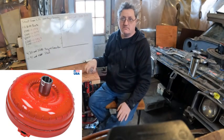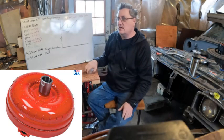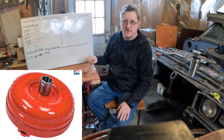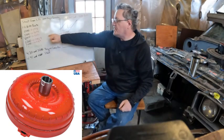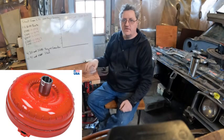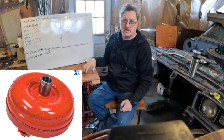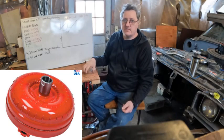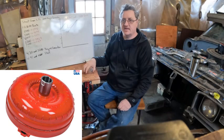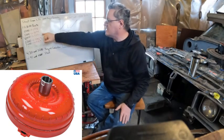Looking at this 3274 RPM drop, you can call up a converter company and have them spec a custom converter, or get one off the shelf, probably a lot cheaper. Depending on the weight of the car, the gearing, and the torque of the engine — if you have a small block without a power adder — you could probably go 3500 and it would be okay. But if you have a larger engine like a 454 or a small block with a nitrous kit, a nitrous kit can add 200 foot-pounds pretty easily, so you want to be conservative. For most people watching this, a 3000 stall would probably be the best choice.